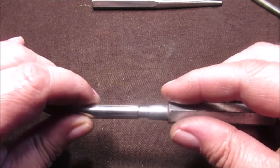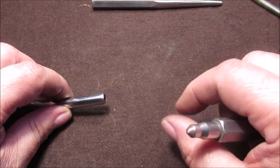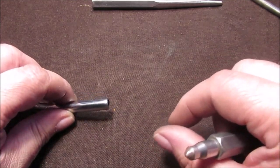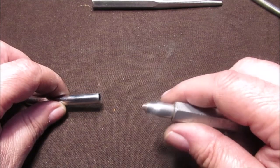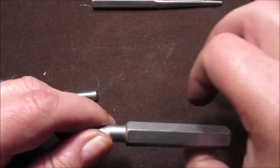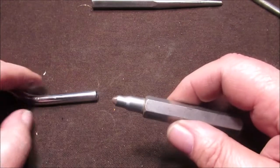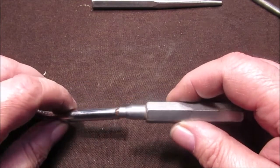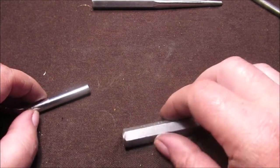They make a muffler tool where you can swedge the pipe, like say it was just a little bit too small to put your muffler pipe in. And that's used with an air ratchet because you'd be there all day long with a breaker bar ratchet. I don't know if you've ever seen one of them. It's a big round thing of metal with springs and it just gets bigger and bigger the more you crank it down. You see the muffler shop use it with the air impact. So that's what that is. I'll take a picture of that just for the fun of it.